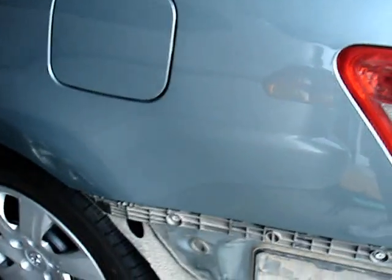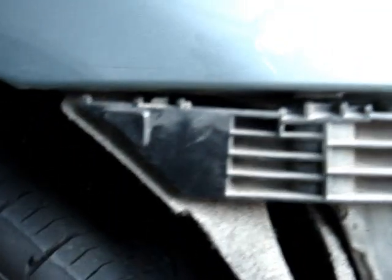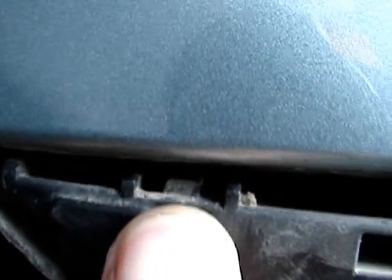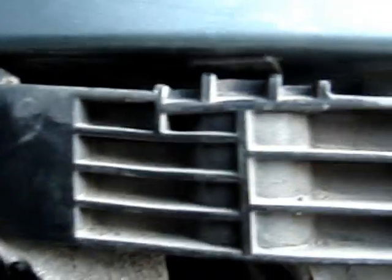then go over to one side and start disengaging the claws, what Toyota calls disengage the claws. What that means is if you can see here, this is the first one in a series, right here. It's basically a little plastic tab right in the center there that sticks up. That little plastic tab fits into a flattened loop in the bumper cover.